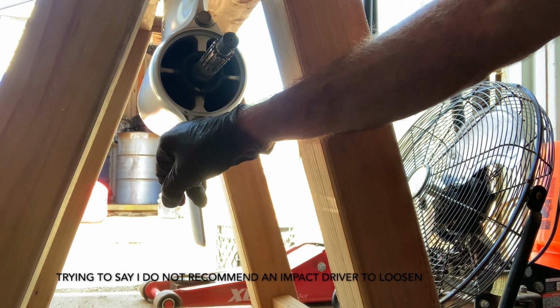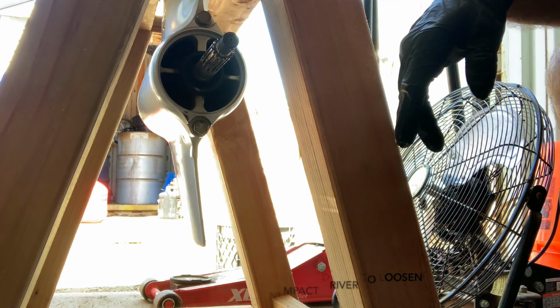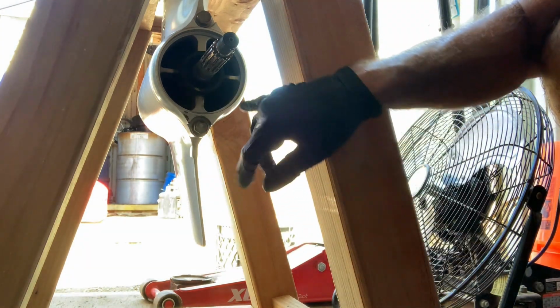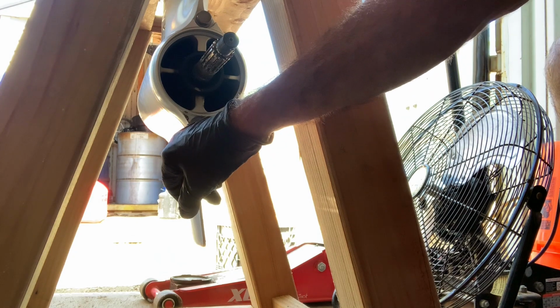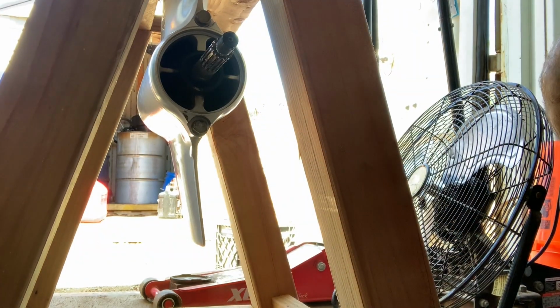They're machine threads on these marine engines, not the coarse threads like you see in a lot of construction outside. So if you try to move something that's fused together in the salt water for a long period of time with those fine threads, if you take a lot of power all at once and try to move quickly, you tend to just take the head of that bolt and shear it off. So try to go with something bigger if you can.